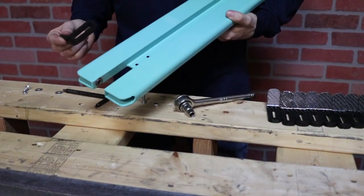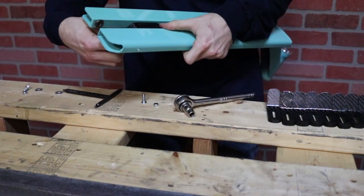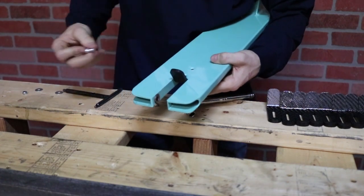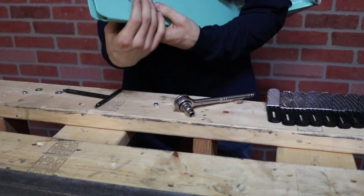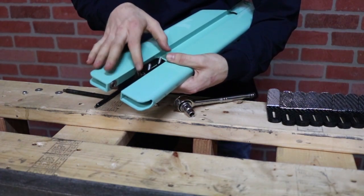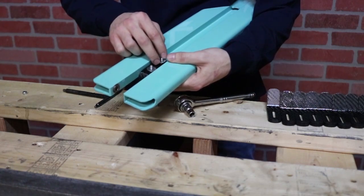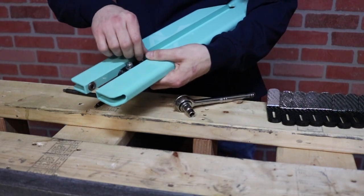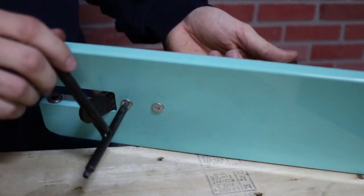So, nice and simple, you'll just take your deck, you'll install the fender like that in there, and you're going to take your 2 bolts, pop those down in, and then just set the washers on like this. And then go ahead and put on the nuts. Then you put the 4mm Allen head onto the bolt.